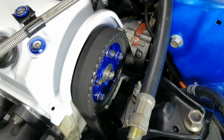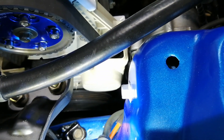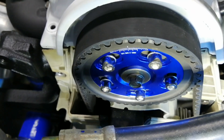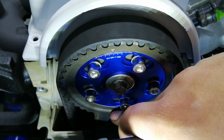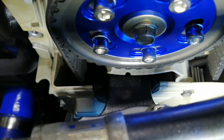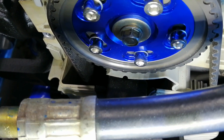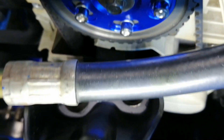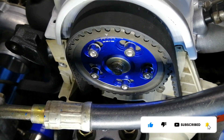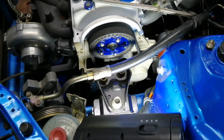As I feared, looking down there you can see the timing marks — they line up at the cam — however the official mark I made on the crank pulley down here should line up with the plastic cover, and as you can see that mark does not line up. It's one tooth off. So I have to loosen the tensioner via that hole there, slide off the belt, turn the cam, and slide the belt back on. Very important: if you take the belt off, make sure the timing is still correctly set when you put it back on.